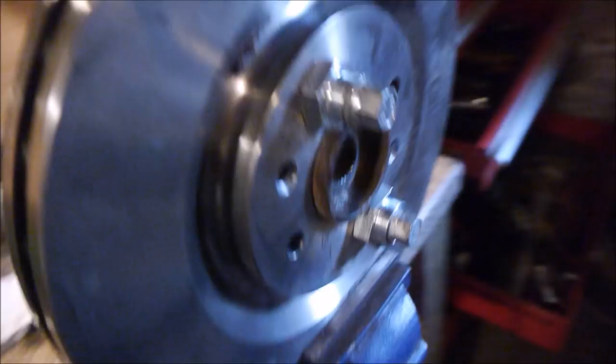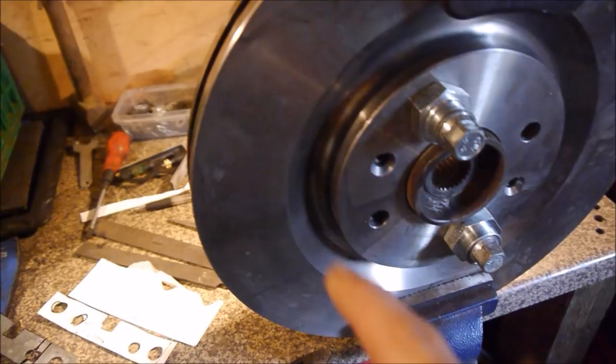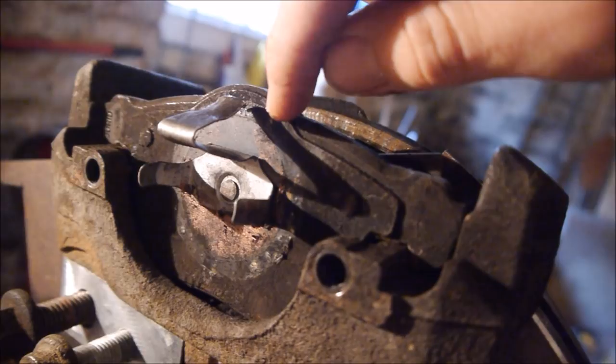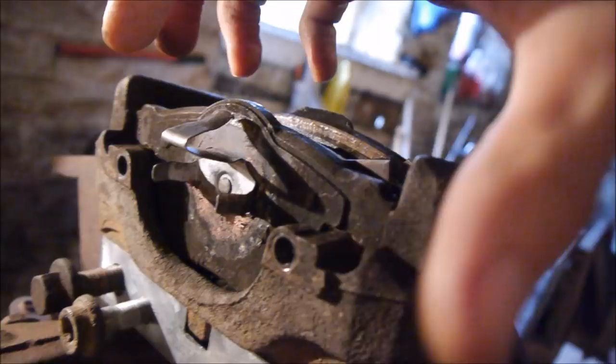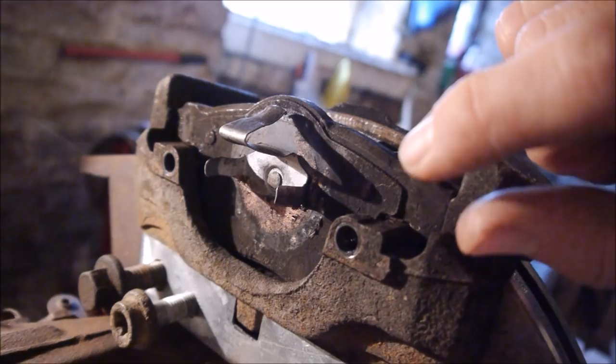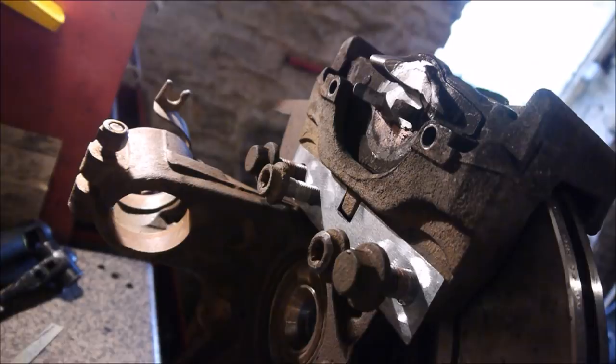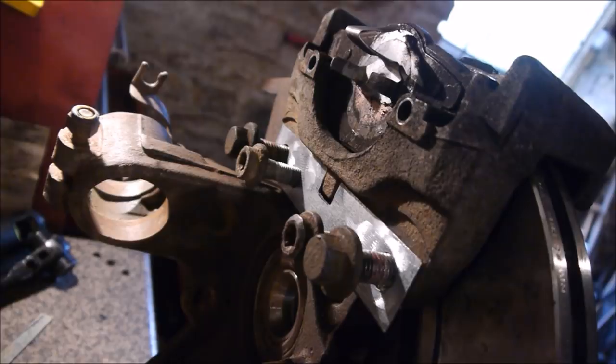We've positioned the caliper because the pads are too tall beside the disc — it can run on the Peugeot, which is something like 326mm I mentioned. I want to get the right overlap; they were almost going to perfectly fit with all the overlap of the pad on top, but if you look carefully the piston runs quite close to the top of the pad. I didn't want uneven pressure on the disc, so I dropped it down a bit to get a little overlap on the inside edge. What I need to do now is send this metal template off with a few measurements to Tiggy, and he will get some laser-cut plates — I'm hoping in 15mm steel — to help the length of bolt, add rigidity, and because the holes are so close I don't want to use 8 or 10mm steel. Then when they come back we can bolt them up to the car.